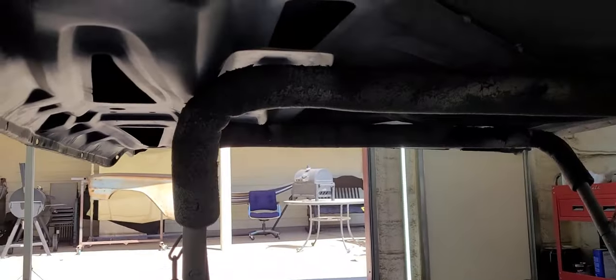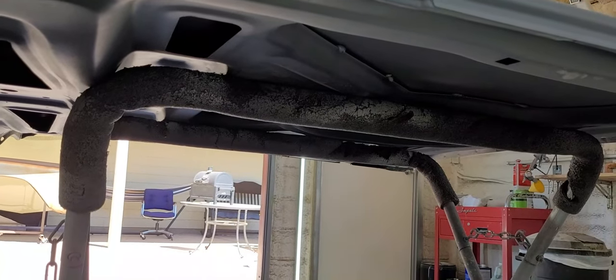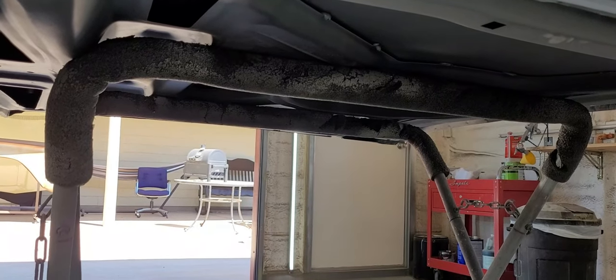We've got some black epoxy, going to use as a sealer. Hadn't really done much to the underside, so the underside is just going to be sanded 400 and sealer. There's no need for primer on the e-coat stuff.